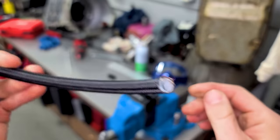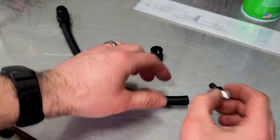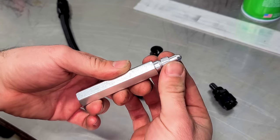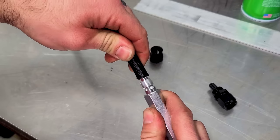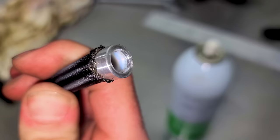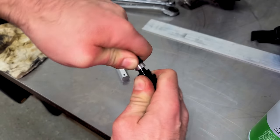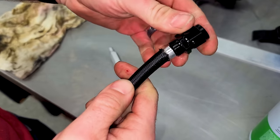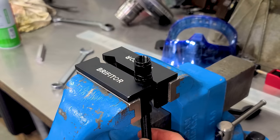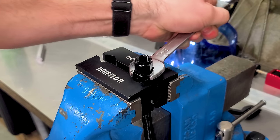I've already fit our hose with one new end. If you unscrew the fitting, you'll find a little collar called the olive that needs to fit inside the hose. Make sure you have this collar chilling in the back. They make a nice tool that centers into the hose and lets you twist and push the olive underneath the black braid and over the Teflon liner. When done, it bottoms out. Spray with silicone spray, push the other end through, snap it in, thread on the nut, tighten in the vise, and we're done.